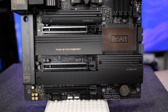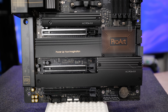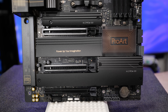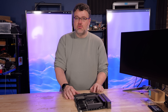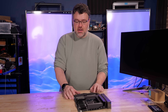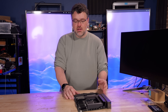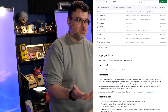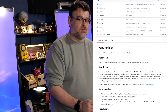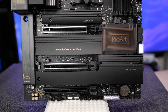The really amazing thing about this board is that it has lots of PCIe Gen 5 support. You've got M.2 Gen 5, as well as two fully Gen 5 expansion slots, plus an X4 slot on the bottom from the chipset. So if you're rocking two full-size GPUs for VFIO or GPU pass-through, you can do that. You've also got onboard video, so you could use onboard video for the host and another GPU for your guest, or use vGPU unlock on an older NVIDIA card for multiple operating systems on a single GPU.